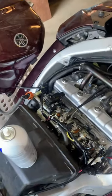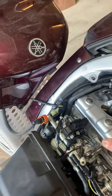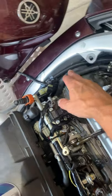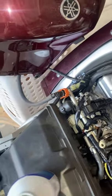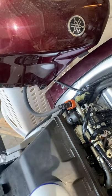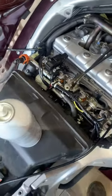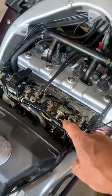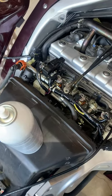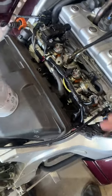This is my 07 FJR 1300. Last year I changed all the radiator hoses, but they didn't have these two small diameter hoses that go to the cold high idle wax valve. About a month ago I replaced those two, and then the thing would not start — it would not cold start. I'd have to pump the throttle, and all along it just seems like it's been a problem with not enough fuel when starting up.